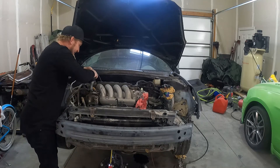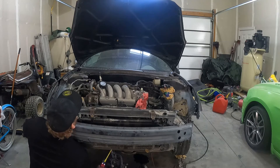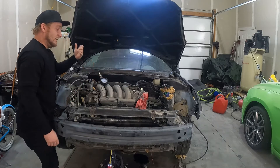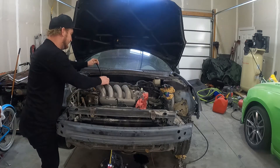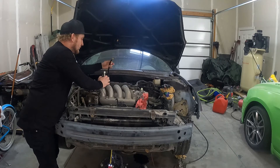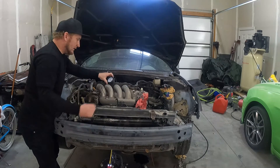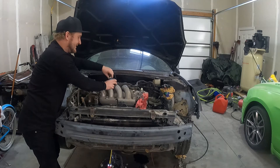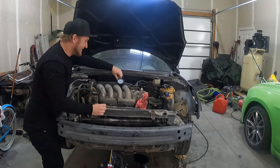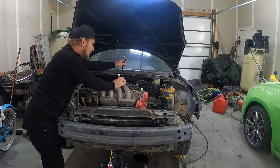Oh shoot, that was awesome. Let's try that again. So we're sitting at 100 pounds — not good enough. Sitting at 150, that's pretty good — higher than the minimum that they require. Sitting at 130, still sucks. Sitting at about 60, still really sucks. So we're going to go through this motor later. Probably going to build this one to be a turbo motor. That's my plan anyway.